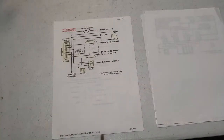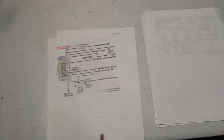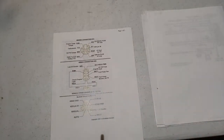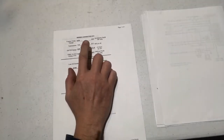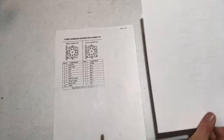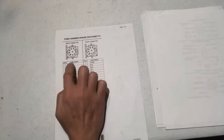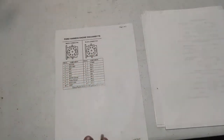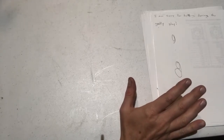This is the TFI drawing — it's on the distributor. There's also a drawing of body connectors to the EFI, showing the oxygen sensors, some dash information, and some of the sensors going into the EFI harness. The last one is the salt and pepper shakers — it shows a pinout of each one with the pin number of each wire. Hope these help. If you haven't printed them off, go ahead and print those out or put them on your laptop or pad so you have them handy while you're doing your harnessing.